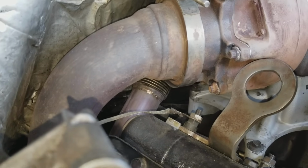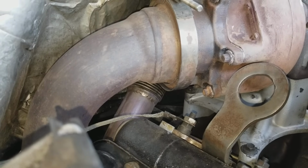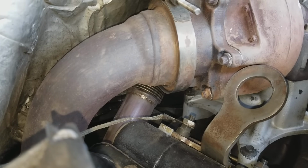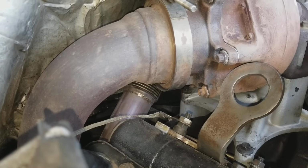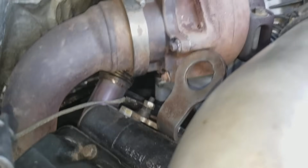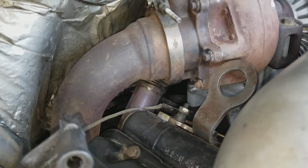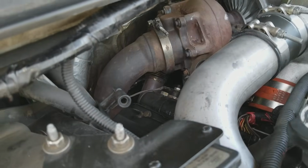Now you might think, well, that's not a big deal, but what it does is you lose some of your low end boost, and like I said, that's the biggest lagger on this truck. When you rev up to about mid RPMs is when you really get your power. The Duramax, I get it right off of idle, so it's a little different as far as that goes. But like I said, it's not a bad engine, it's just got its issues.